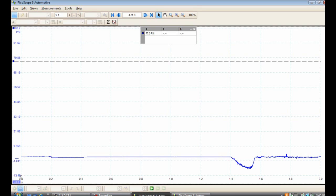Just from experience, when we cranked it over, it sounded like it didn't have compression on any of the cylinders. So we thought this was suspicious, and just as a pure gut feeling, we decided to use the pressure transducers to measure cranking compression. I used my setup hooked to cylinder one, and we hooked it up and this is the waveform that we got.